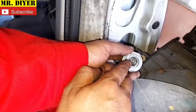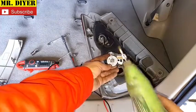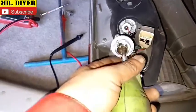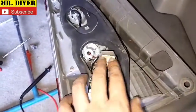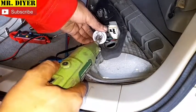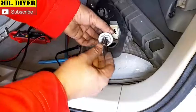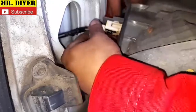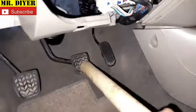Ultimately, the reason for our brake light not working is just bad contact. What I'm going to do now is disconnect the wiring harness and clean the terminal using a wire brush as well as a mini grinder. The reason I disconnected the wiring harness is because if we brush the terminal while connected, we could short things out — that's just a precautionary measure. So I'll slightly brush the inside of the terminal, give it a brush too. Let's plug the bulb back in, reconnect the wiring harness, and let's see if this lights up when we press on the brake. Same procedure — step on the brake, move the seat forward — and as you can see, we have brake light here and we have our brake light there.